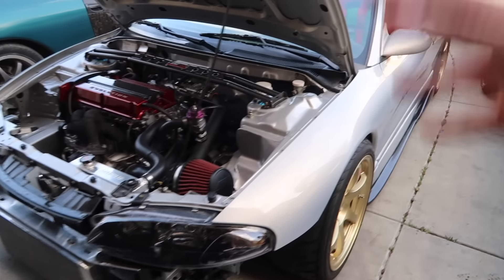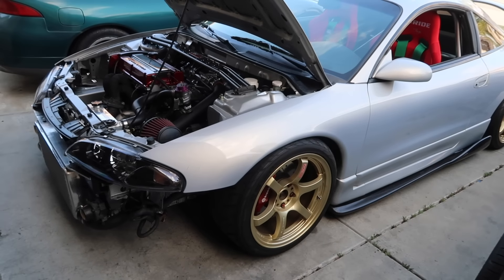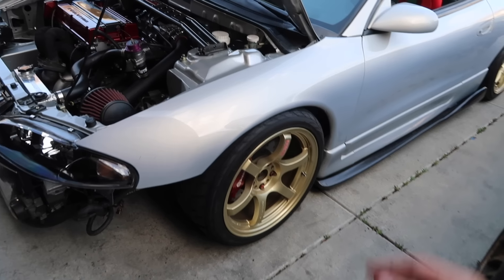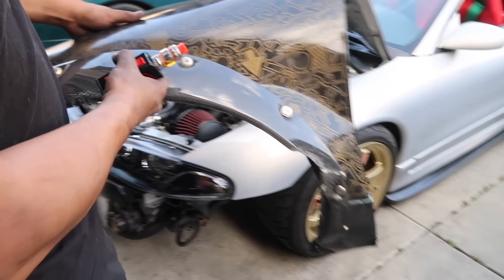When you're test driving, here's how to check the clutch: put the car in third gear from a dead stop, let go of the clutch like normal, and don't give it any gas. If the car dies out, the clutch is still good. But if the car keeps going and doesn't die out, then the clutch is slipping.